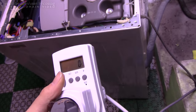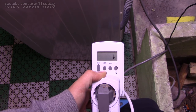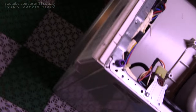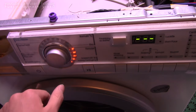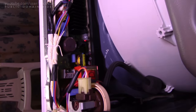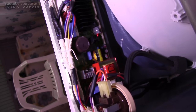The board is now nice and warm and I've got an energy meter, so let's see what happens. Did that do the trick? It did have a bit of a struggle but yep, we're back online. So that's great news - that means it's highly likely that we've got a bad cap in there, and we've got the red LED showing us when it's on. It's probably going to be one of the little boys.